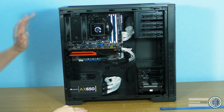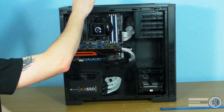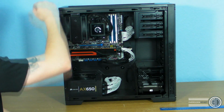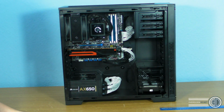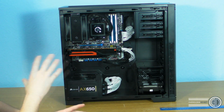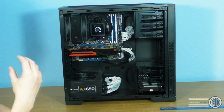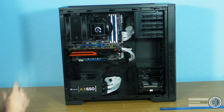Like I said, the only thing that you can't fit in it is the H100, and that's because there's not enough room between the roof of the case to be able to get the fans and the radiator in. If you fitted the fans outside, that would be different, but it looks silly then, and I really don't think anyone's going to want to do that. And also, buying a £60 case and a £90 cooler is not going to mix. But I just wanted to make that very clear from the beginning that it natively does not fit.